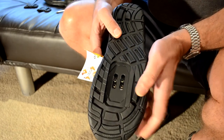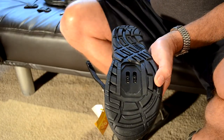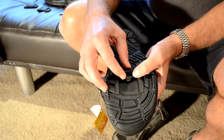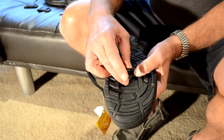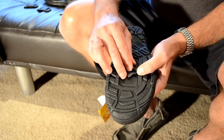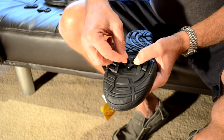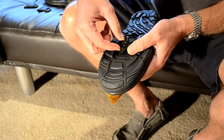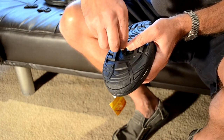What we'll do now is put it on and then check afterwards. There are four parts to any cleat: the cleat itself, which you position with the large elements at the back and the small elements at the front; a gasket or holder; and two screws. The screws fix on using an Allen key fitment.